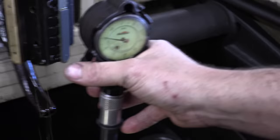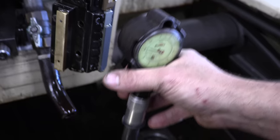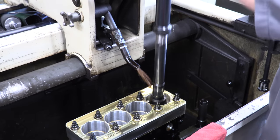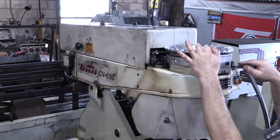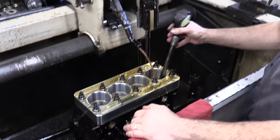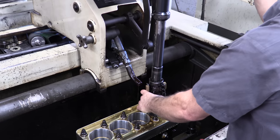As you can see, we've only removed a couple of tenths. We've gone from about 2.5 to about 2.8. That's getting closer. It will affect your engine's longevity, its final compression ratios, crankcase pressure, oil quality, and even emissions. So choose wisely. Follow the directions for your piston materials. That's all the science there is behind doing this correctly. Just think about how you're going to use it, and if performance is the goal, it's okay to be a little bit loose on your piston to cylinder wall clearance.